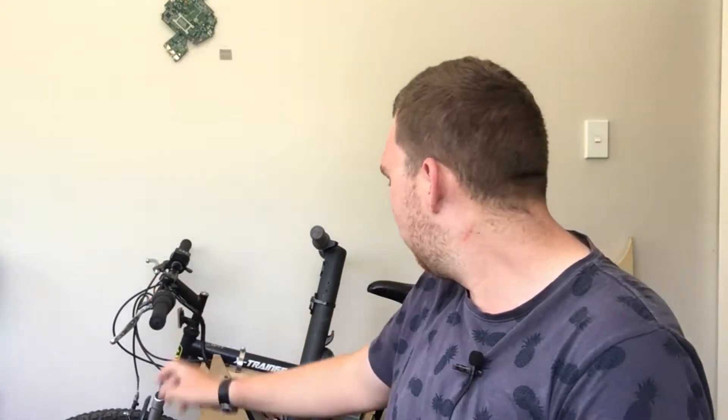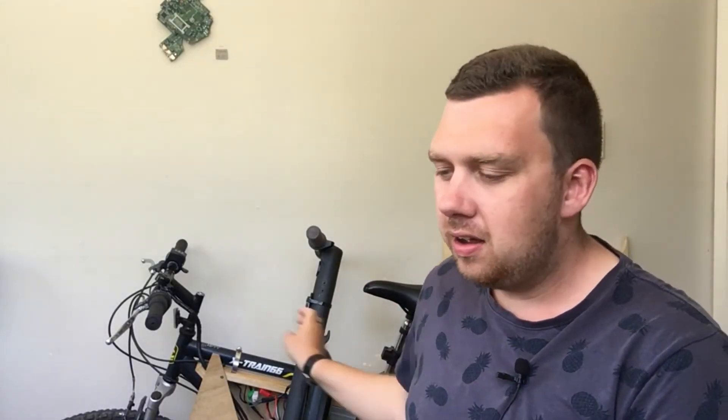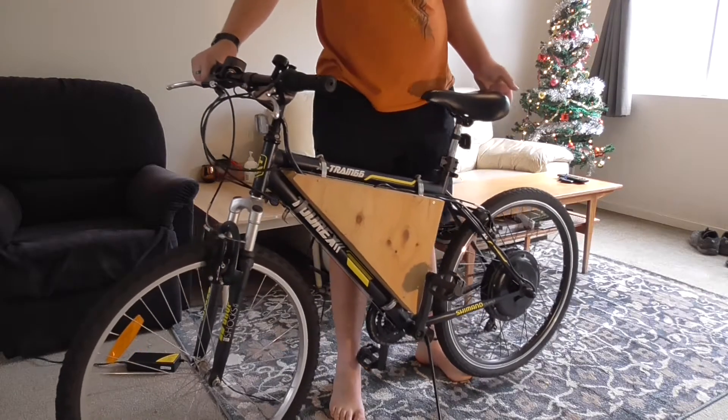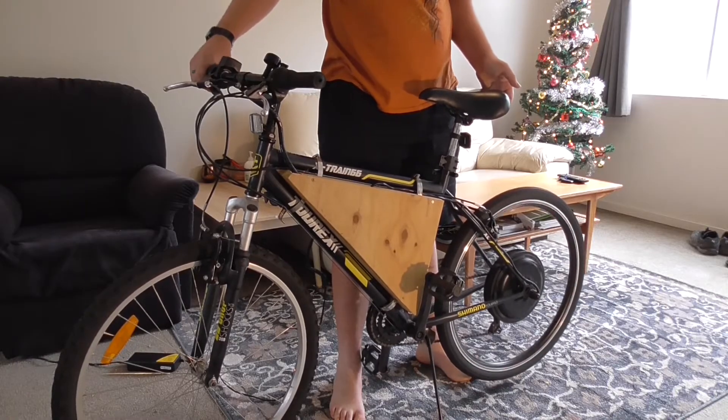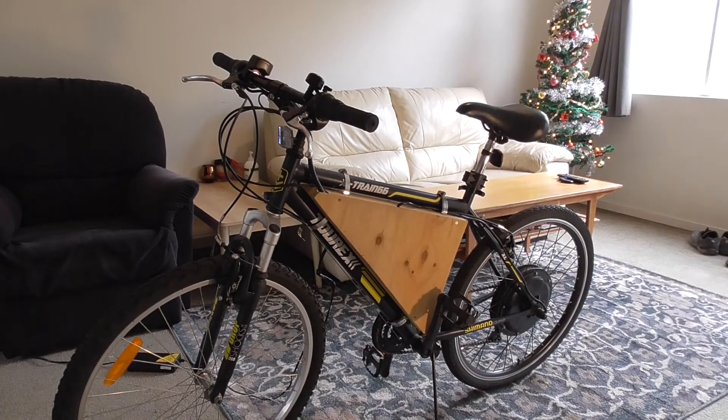About a year ago I built this electric bike here, made a little frame up for it, filled it with these horrible lead-acid 12 volt batteries - four of them, very heavy. The range is about two kilometers, it's terrible. I want to experiment with putting my scooter battery on there and also maybe my drill lithium battery. It goes about 45 kph but the problem is it'll only go about two kilometers range on these horrible lead-acid batteries.